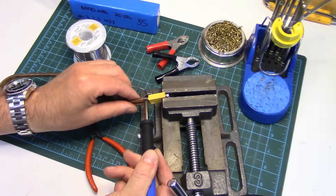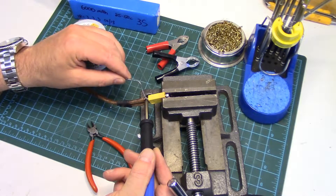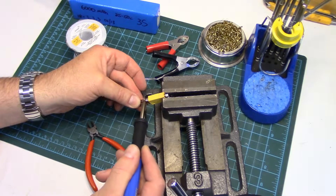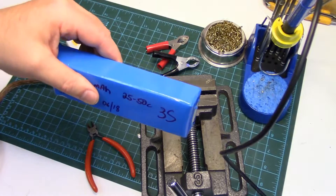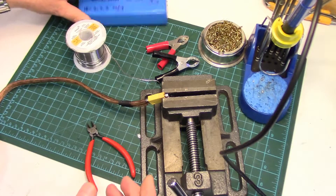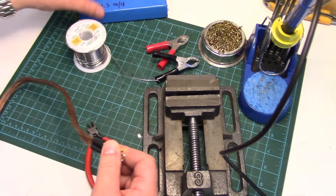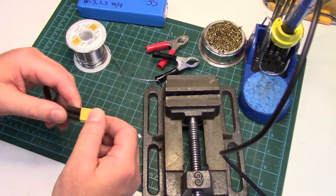I think it should work fine, but the main thing is you do not keep the battery hooked up to the mower after you boost it. Once I get it started I don't need to start it again, that's why this will work fine. I'm gonna leave the other battery still in it — obviously you don't want the mower charge circuit open. That's why you want to disconnect this as soon as it starts: lithium packs need to be fed nice clean voltage to charge them. They use the constant current, constant voltage charge method, and you don't want dirty oscillating magneto voltage with a single rectifying diode going into the battery — you'll destroy your 3S pack. On that thing the voltage varies depending on RPM.